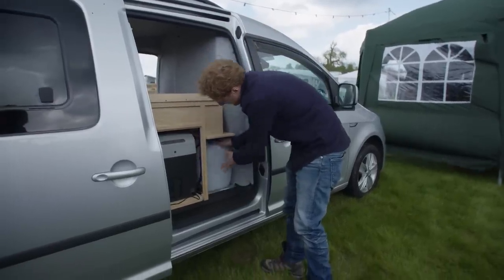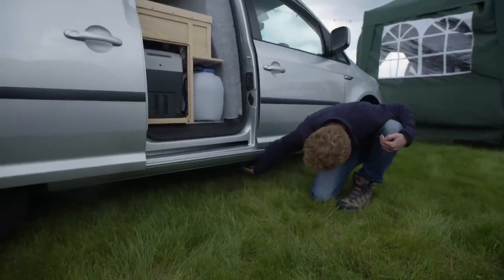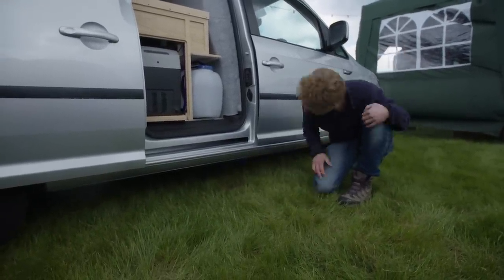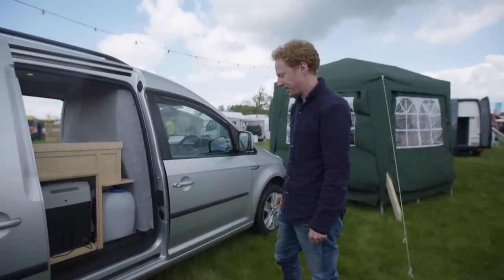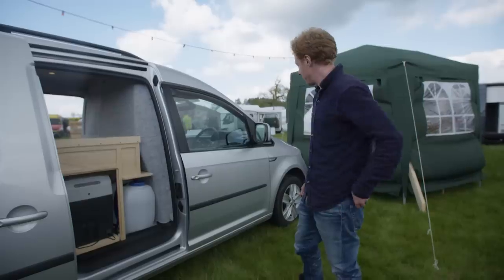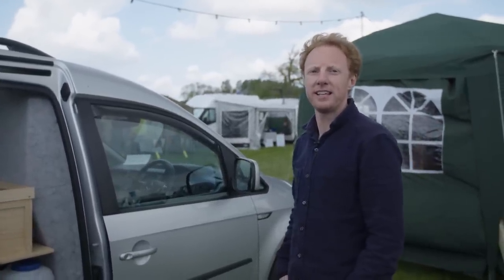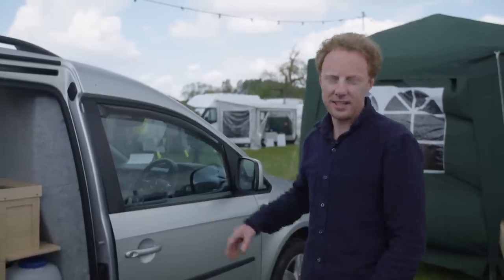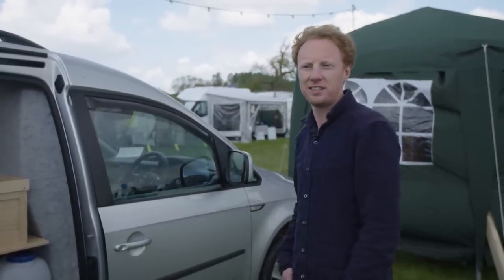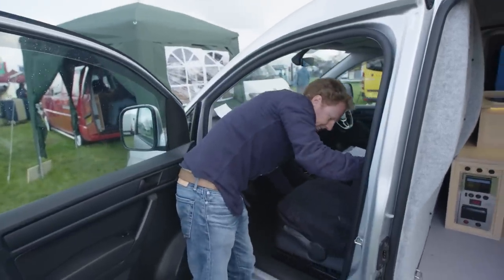The 240 volt mains hookup is underneath the van, bolted to the chassis itself, so that when you're on a campsite you can hook up without tripping over the cable at the front of the van. It's also quite neat — you don't have to cut a hole in the side of your van or show other people that you're a camper van at all. When all the doors are shut, it looks just like a regular panel van. The leisure battery is charged by a voltage sensitive relay which comes straight from the vehicle battery to the leisure battery. I don't connect the vehicle battery directly to the consumer unit in case it drains by mistake. It can also be charged by the mains inlet — there's a battery charger in the consumer unit as well. The leisure battery is stored behind the passenger seat, and there's a footwell space where you could probably fit two batteries if you wanted.